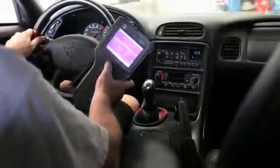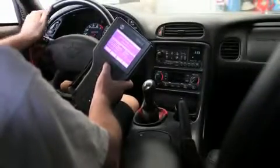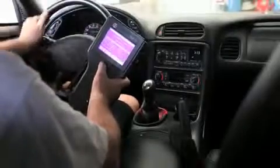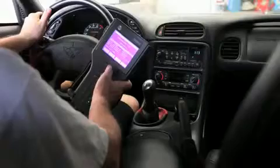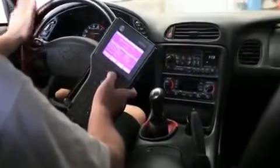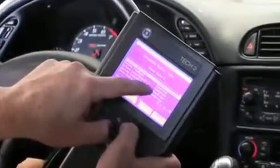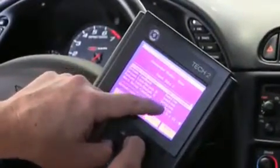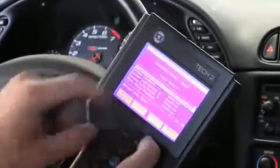Right now we're locked. We're going to hit unlock, and you can hear that actuator cycle, and now the wheel moves back and forth. If we go to lock — you heard the actuator cycle. If we watch the column feedback and lock, unlock A and B, you'll see those cycle. You will not see the ignition off locked state change.